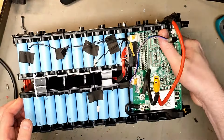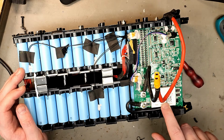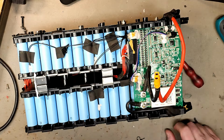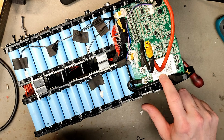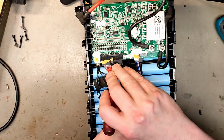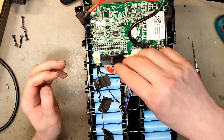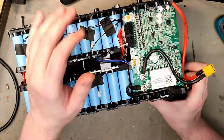Very similar to the NIU BMS. It does say TP here, which indicates it might be Tenpower cells, maybe even Tenpower that built the battery. Or this is just a reference to the cell, TPENR18650HE2. It does have the same two-row ESD as NIU, but that's probably common. Can we even remove this? I think the cells are in the way.